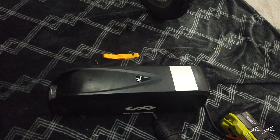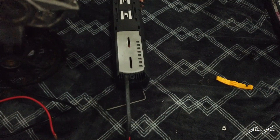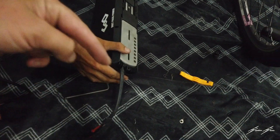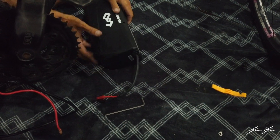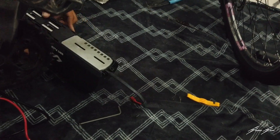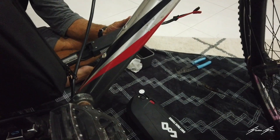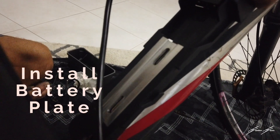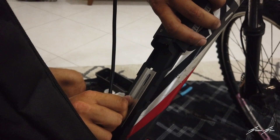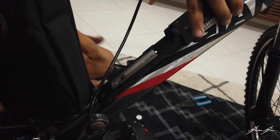It should probably take him about 25 miles or so without pedaling. But if he goes on his big long excursion, he'll probably go about 40 miles if he's pedaling. We're going to try to remove that plate from the bottom of the battery — it slides this way. Just push maybe with the palm of your hand. Got it. Now we're going to install this battery to his bike on the mounts. It's going to go that way because that's the only way it's going to fit. Notice how the steel will really support the battery as he puts these bolts back in. Fortunately for his bike, it lines up perfectly — if not, you'll have to improvise. He has a nice large area here to put the computer and the battery.